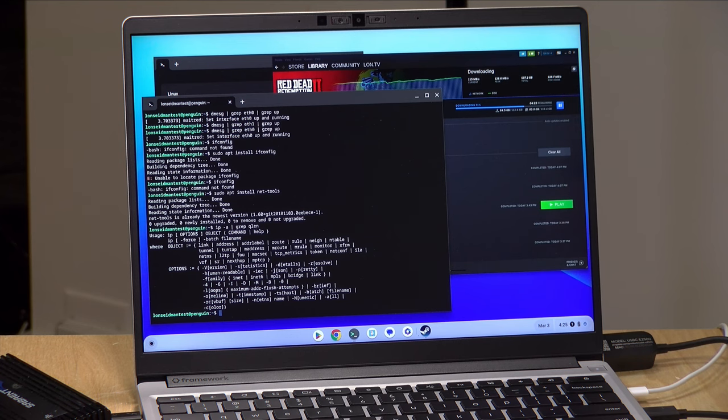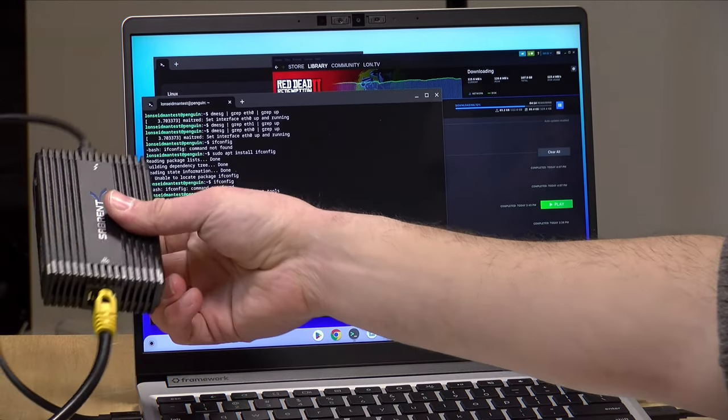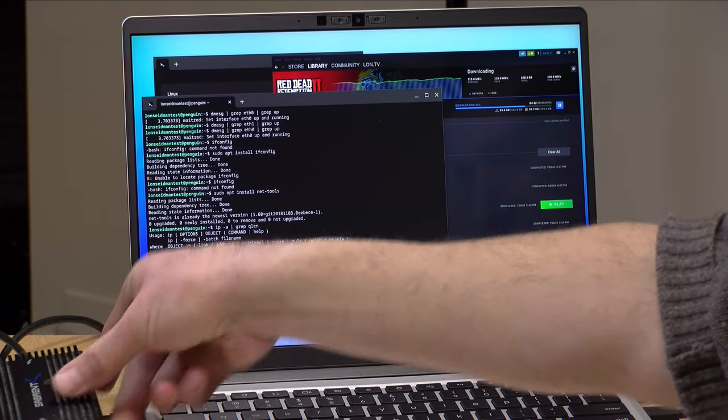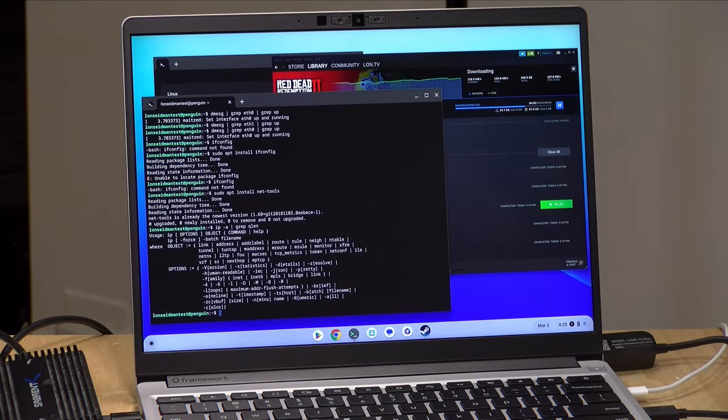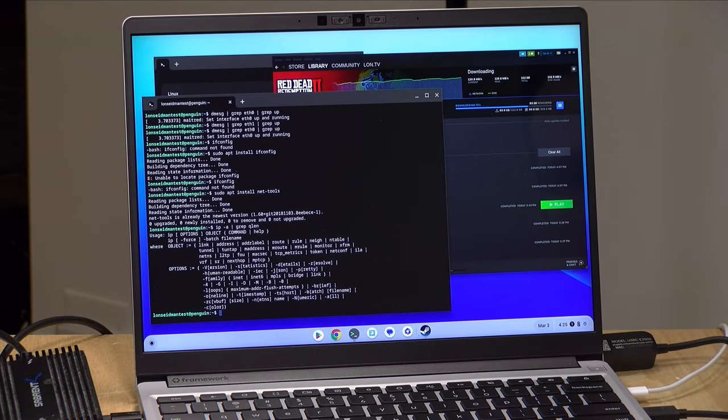Maybe what I'll do is I'll reboot it fresh and see what I can push it to. But the fact is that this Thunderbolt Ethernet is working. And it's working faster than a gigabit. So you know what I'll do? Let me go into the room just to make sure, because I can't remember what the lights always align with there. So, oh, you know what? No, yeah, so the adapter has negotiated a 10 gig link. So it's talking at 10. It's definitely running at 10, but I'm not sure why we're not getting more than that.